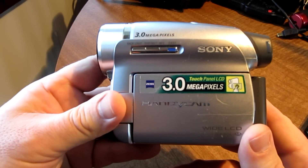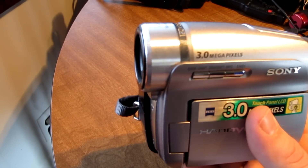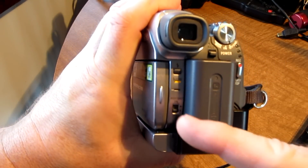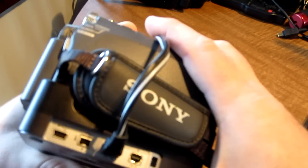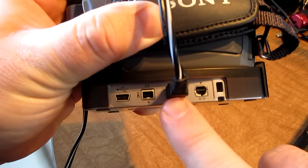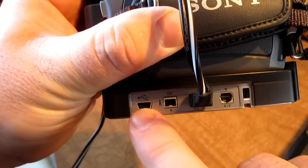What I want to show you about this camcorder really isn't so much about the camcorder itself — it's what's inside it. The programming that's in there converts over to DV, and it does its interface through this docking station. If I take this camera and install it in the docking station, you'll see it charges the battery and gives you access to a whole bunch of ports. This one allows for audio video in to the docking station interface with the camera. This is just the power. This is a 1394 mini DV or i-link that's a 4-pin. And this is a USB.